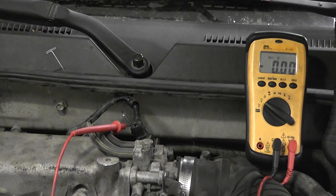Do you have a bad sensor? Most likely. Do you potentially have a short to ground in the signal wire? Of course, this is a procedure you would do after following your 5-volt reference check and checking your ground, sensor ground, and making sure those are good.